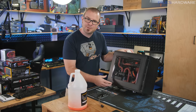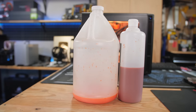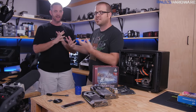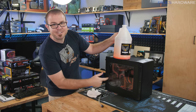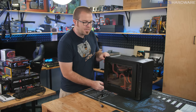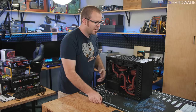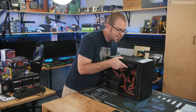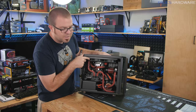If there's any indication of that, you might notice the color it is right now compared to the color it was in my initial B-roll shots. I actually still have the rest of the coolant from when I initially put this together — and you can tell this coolant that hasn't been used and heated over and over again and passing through a loop for a few years is a little bit differently colored than the coolant that's in there. The other thing about this coolant is you're not supposed to just dump it down the drain — I believe it has heavy metals in it. So I'm going to attempt to drain this, collect it in this old coolant fluid bottle and try to dispose of it properly as you would motor oil. Fortunately, I did install a drain valve on this system when I first put it together.